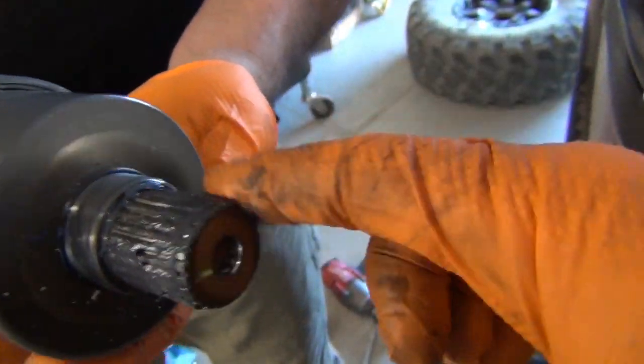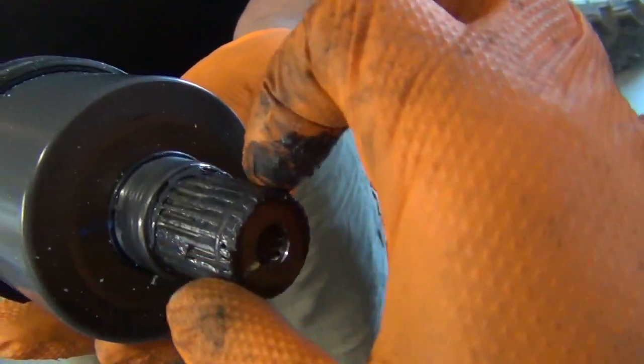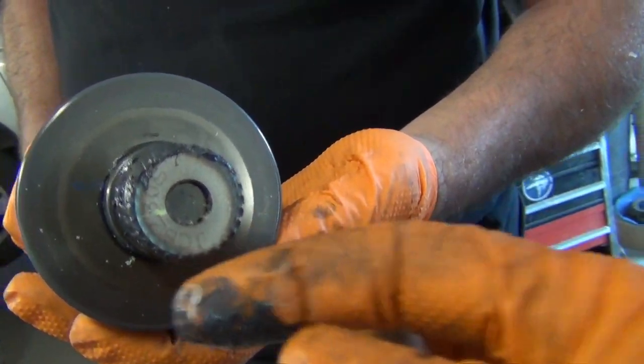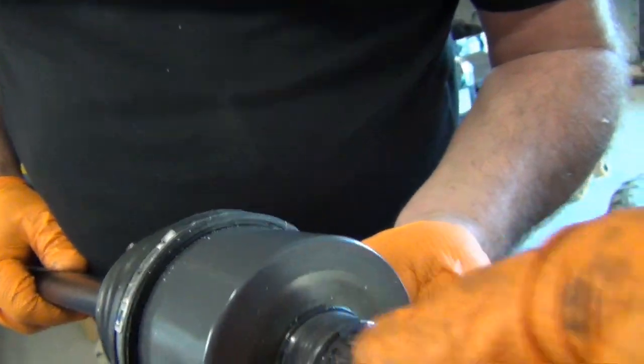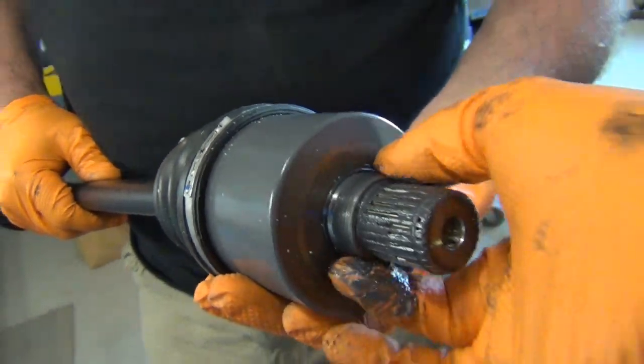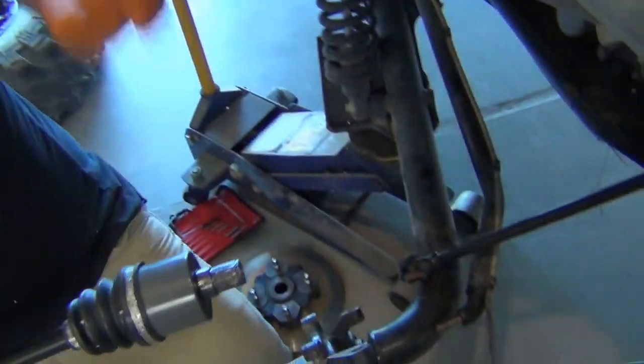What the grease does is it makes that ring float in the middle. Some of these will be loose, some will be a little more tight, some you can rattle up and down. And if they hang down, then they block to where the splines can't get through. If I just go around like this and make sure that it's sitting in the middle, there you go, that's efficient. Excellent. You take it and you basically use it like a slide hammer.